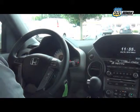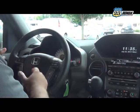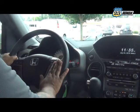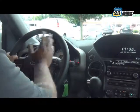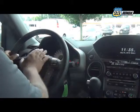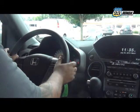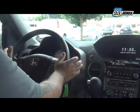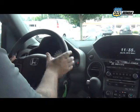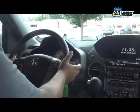Below that, you have your Bluetooth options — your pick-up and hang-up buttons. I'll get into that later in the video. On the right, you have your cruise control. Hit the cruise button, make sure the cruise main light comes on the dash. When you're driving, get to a speed you're comfortable with, then hit the button that says set and release, and it will set that speed until you hit the brake pedal.